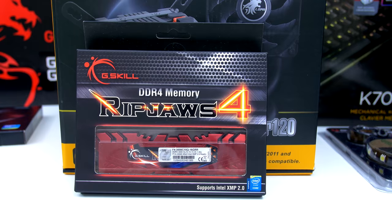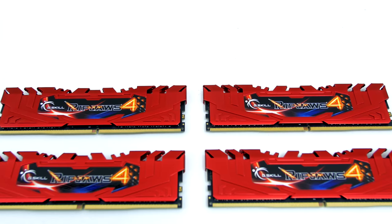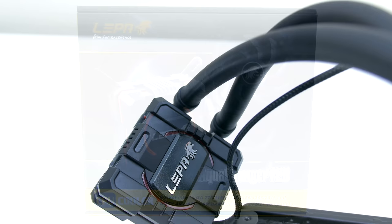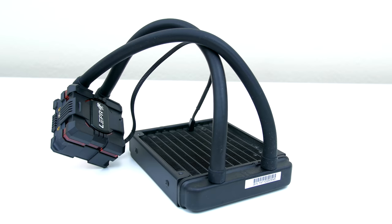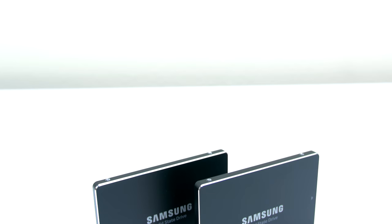I should have the SLI bridge by the time part two is uploaded. Since this is an X99 build, I had to go with DDR4 RAM. I went with the fastest memory I could find at 3000 MHz — G.Skill was the obvious choice, and they look pretty badass too. For cooling, I went with the Lepa Aqua Changer 120mm. The case doesn't support 240mm radiators, so I couldn't go with the Corsair H100i GTX, making the Aqua Changer the next best option. With fan speeds between 500 and 2300 RPM, it will provide enough cooling when I overclock the CPU.